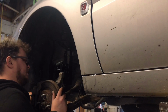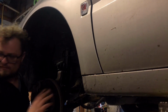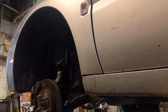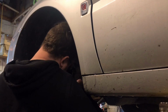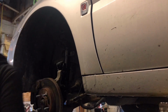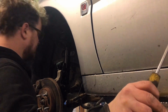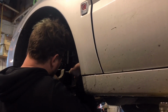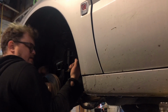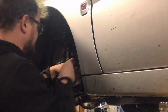Now we got to raise the control arm up to the strut. This one's going in really smooth. I like it. I'm going to use a 3/8 extender. Stick it in place. Maybe a quarter inch extender. These holes are kind of small. Get in place. Use a screwdriver to help line it up. We got that extender in the bottom hole to kind of keep it straight enough.